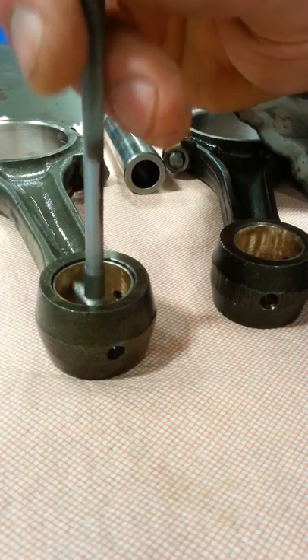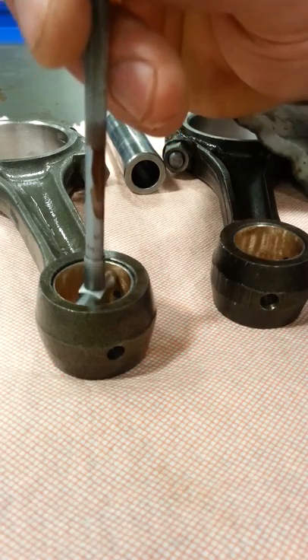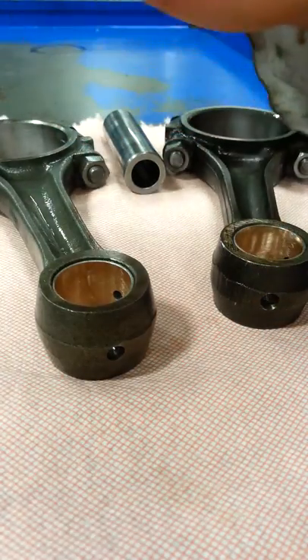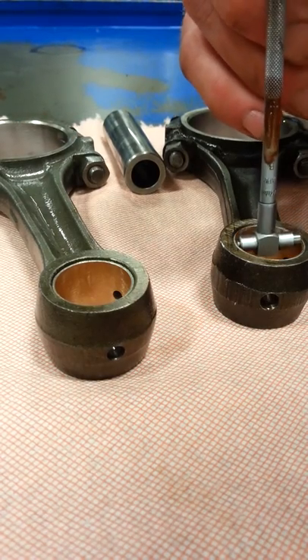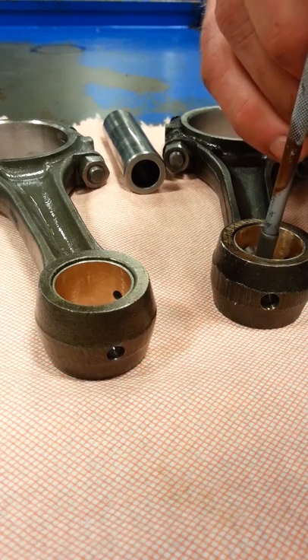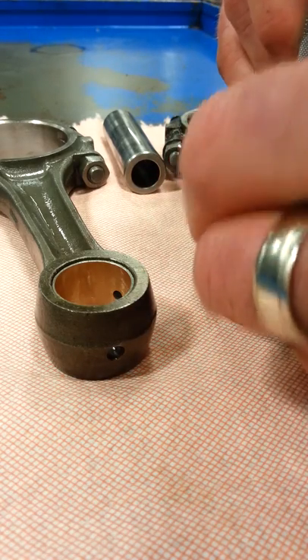These tools typically feel like the feel you would attain when you're using a feeler gauge for a valve clearance spec, or bottom end spec for side clearance on the rods. So I'm going to take a look at both of them - this one's a little looser than the other one, but it still feels pretty good. I'm just going to snap that measurement in this one also.